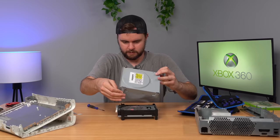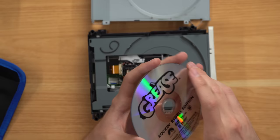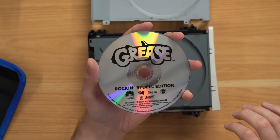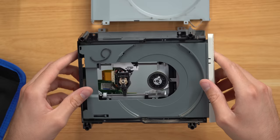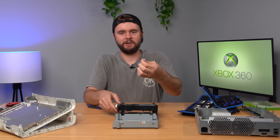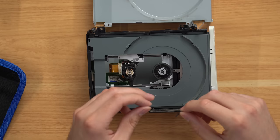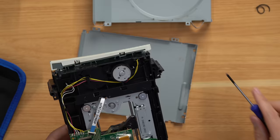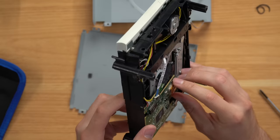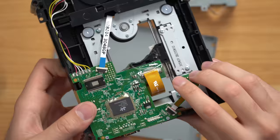We have a free disc — Grease. What a random thing to have inside of your 360. The Rockin' Rydell edition — awesome, it's free, can't complain. Let's take a look at this thing. The disc top looks okay. There it is — hold on, how did I miss that? The band is just laying on top, snapped in half — that's brutal. I can just pull it and it'll probably snap again. It looks like my theory is true. I'm guessing that band is just completely gone. I just flipped it over to the bottom and we have some tape just holding the ribbon cable in place. Why? The ribbon cable looks like it's plugged into the connector just fine, but it's got this tape on top of it holding it down, and I don't understand why. I'm just going to leave that as is for now.